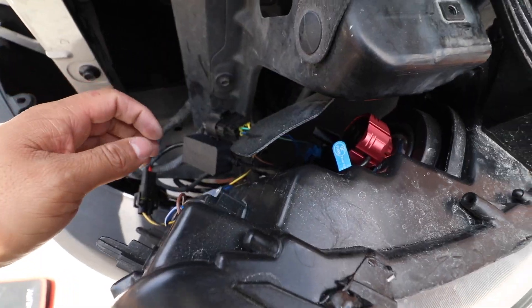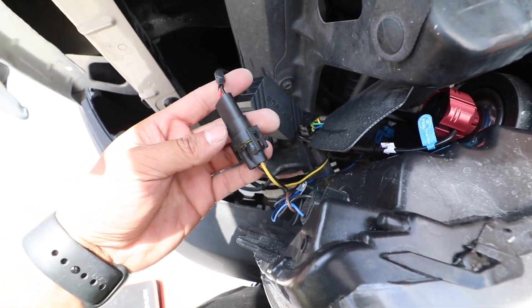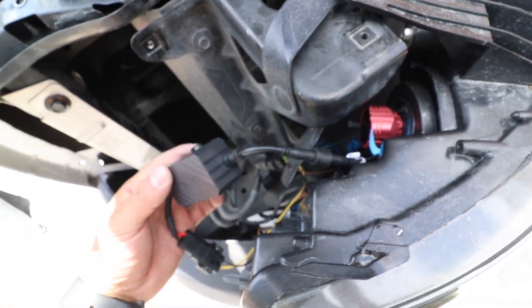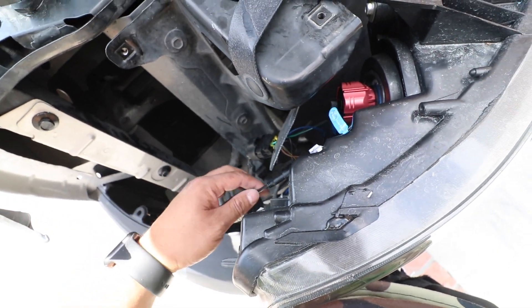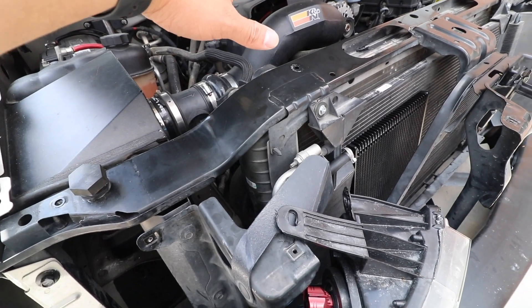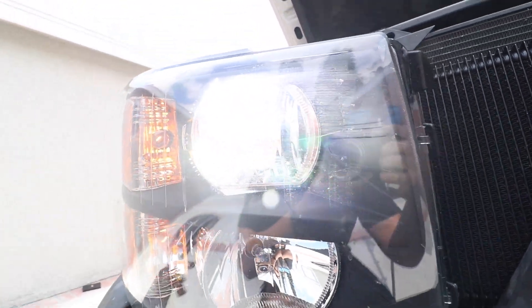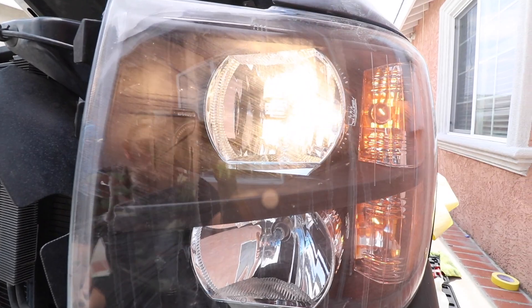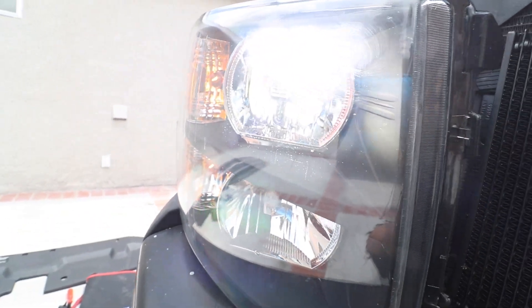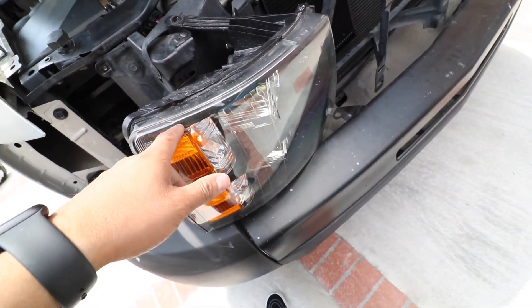So it's locked into place. Now I'm going to connect this with the ballast. I finished plugging it in — it's literally this little plug here, and then this plugs into the OEM harness right here. And then this is the ballast — really, really small. I can either leave it like this or just zip tie it so it doesn't move around. Let's go ahead and turn on the lights inside and see how it looks.